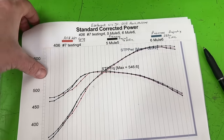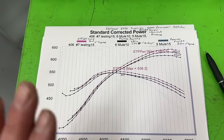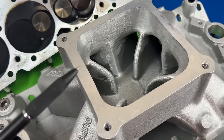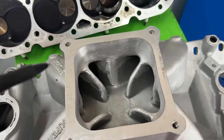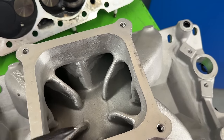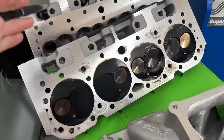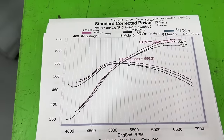Let's go to a different intake manifold. The intake used here is the Edelbrock 2970. I'll stop to show you this manifold — it's a dominator flange and I did modify it: I cut off the clover leaf inside (before and after testing showed it was worth very little), and I rounded the edges (also worth very little). However, the intake works pretty good. It's not port matched — stock, never been port matched — so the heads are just as they come from the factory. It doesn't look pretty but it does a pretty good job.